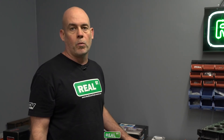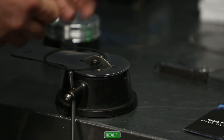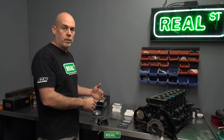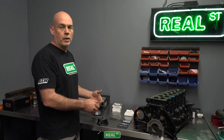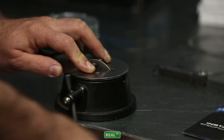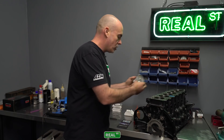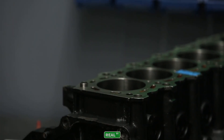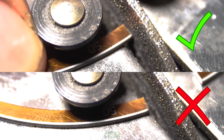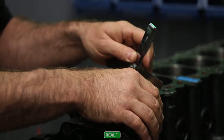You're going to file in one direction off of one side of the ring. You're going to be careful to not load the tool up against the ring so much that it can cause it to chip. This is a motion that you're going to do very easy. You're more trying to glide the cutter over the end of the ring instead of forcefully cut it. If you use too much force, you'll damage the ring and you'll have to get another ring set. So we'll just work slowly in one direction, then go back, re-square the ring, and measure again. When you put the ring in the filing tool, make sure that you have the ring square against the cutter so you don't end up cutting taper into the end of the ring. It's easy to take material off and it is hard to put material back.